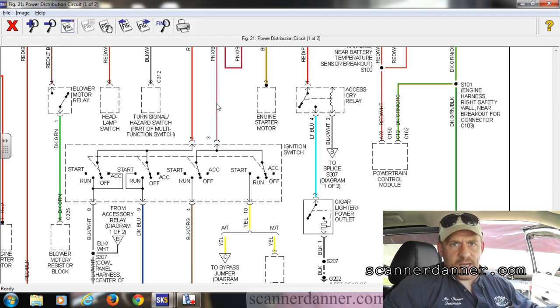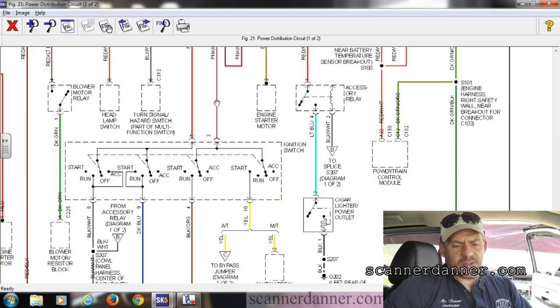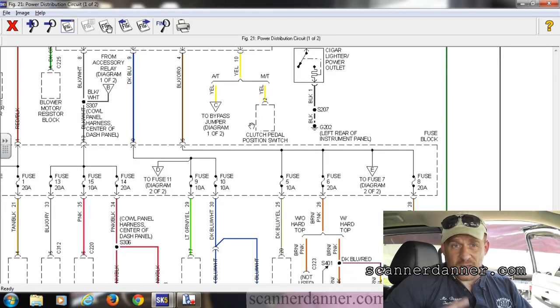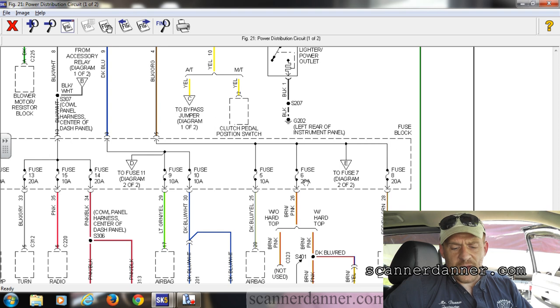How do I know it's on the control side of the circuit? Because of wiring checks that the garage owner did before I got here. I'm going right to that ignition switch to do that check on the pink-black, and then I'll check the yellow. Before I do that, I'm going to check fuse numbers five, six, seven, and eight to see if they have power.